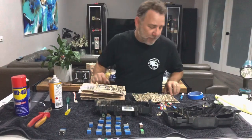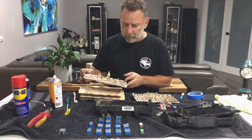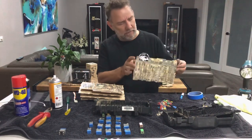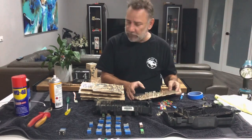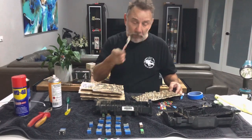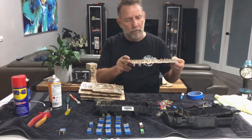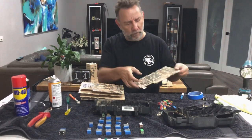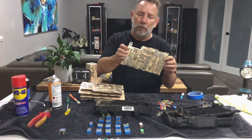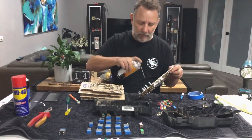I'm back. I've had a thought — I'm going to order a new board just because I want the reliability, but seeing as this board's here, I want to try a couple of things. The first thing I just tried was some alcohol — spray the alcohol on, then the old toothbrush, give it a scrub. But what I've noticed is on these boards you have all these plates and that debris and water has washed in under those plates, so no amount of scrubbing is going to get that out.